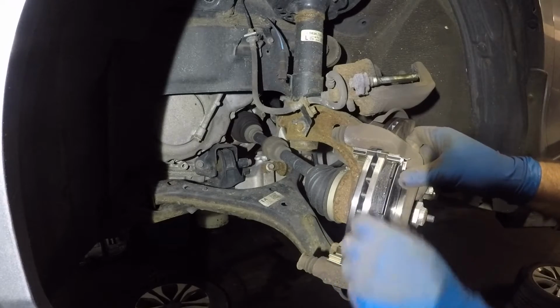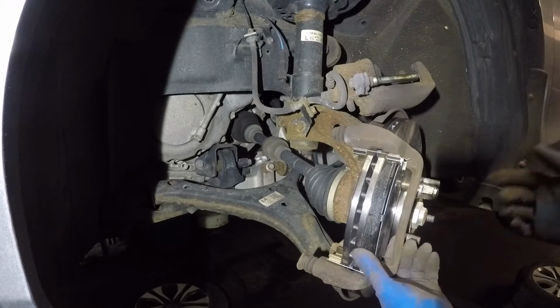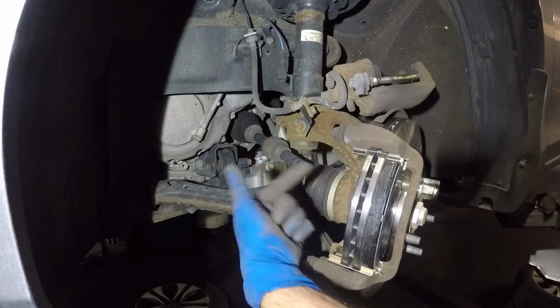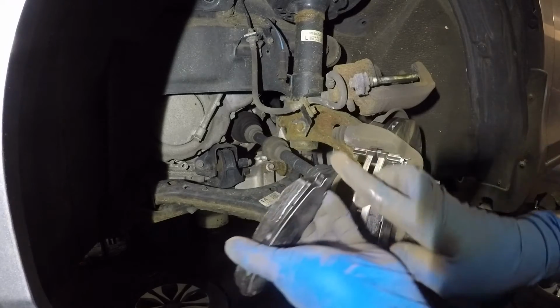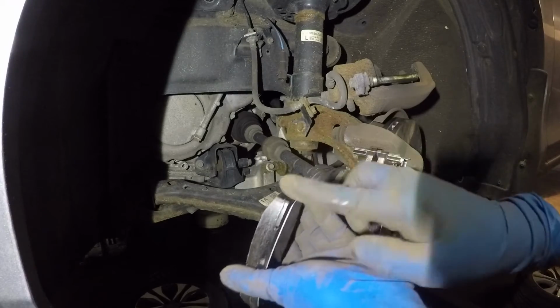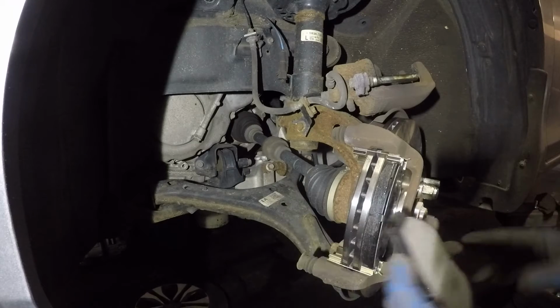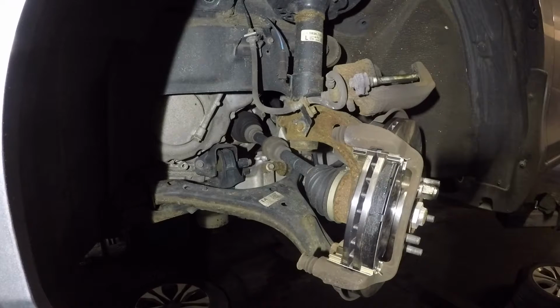And we're gonna put the brake pads in, guys. These brake pads are very good. You never have to, I mean, I can't say never. Sometimes you do have to file the edges. If your brake pad was stuck like the one I had inside, just take a file and file it. Scrape it a little bit here, there, in the sides. And make sure you don't scrape it too much and the brake pad is free in there, right?